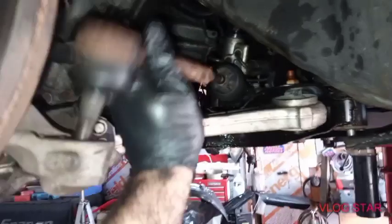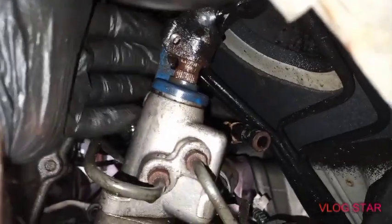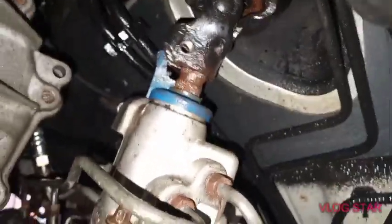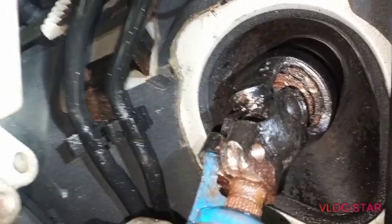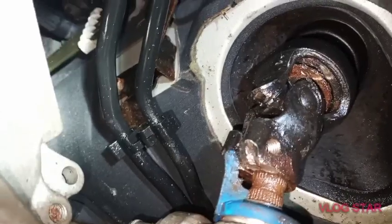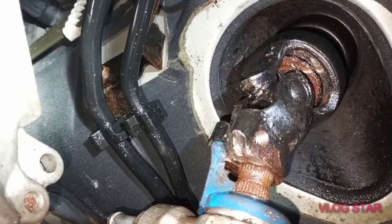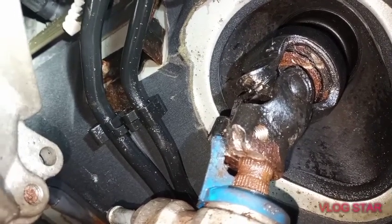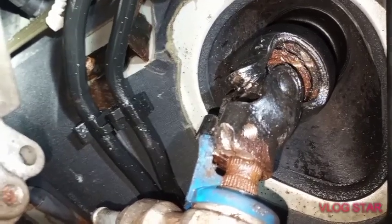Here's the new one going in — steering straight and lining up. Like I said in the beginning, the blue plastic piece is going to go between the coupler — just put it in to line up the spline. That way you don't have to do alignment and you don't mess up the clock spring. Put it back the same way you took it out.